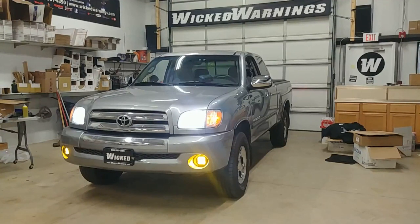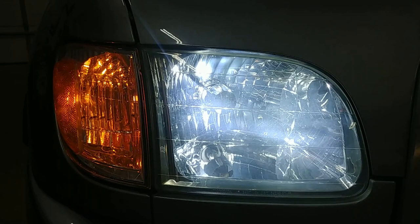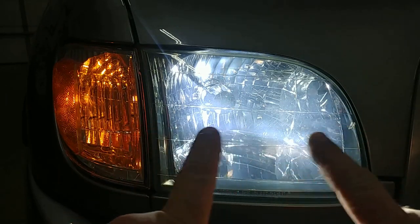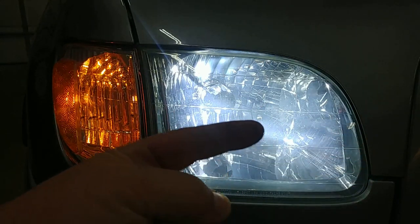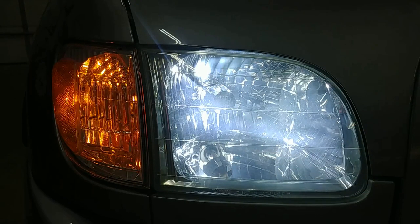But as I said, it's a very extreme tight fit. Here's a close-up of the LED headlight. When you install the LED headlights, you want to make sure that it's vertical and that the light is shining out to the sides. The LED chips should be facing this way and this way — the light should be primarily vertical — and then it'll have the best performance.